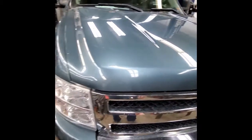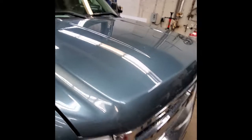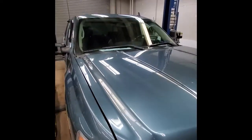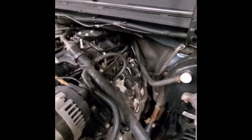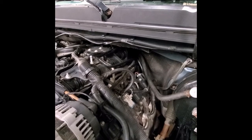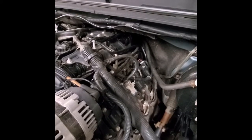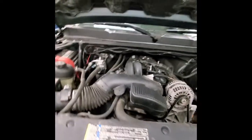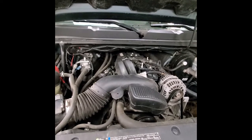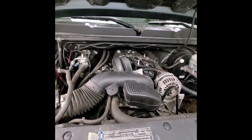Welcome back to another episode of Advanced Automotive. This truck might look familiar because it is mine. I've been battling an issue with the oil pressure sending unit not receiving any feedback. There's a screen below the pressure sending unit that I need to get out and clean. Unfortunately, it is buried way back in the darkest area — but today we have to go in, so let's get it pulled out.